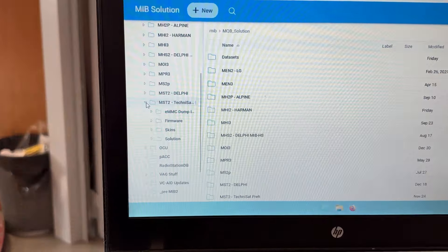Now that the file is ready we can remove the SD card. Also remove any SD card already in your unit — if you have navigation maps or music on it, leave it empty. You can also remove the CD if you have a CD drive. Then insert the update SD card into the unit — you'll see 'Software update is available.'